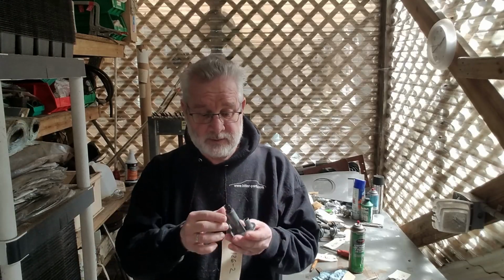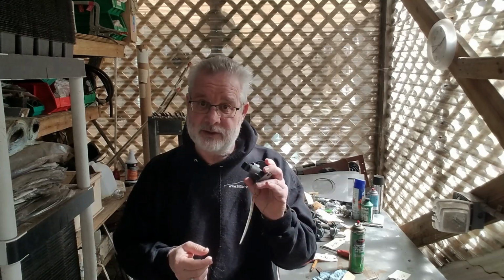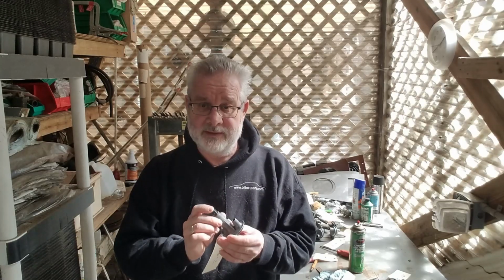If you see mega ohm, something is not right. In the case of that particular one, I had infinite resistance, and then finally saw how badly corroded the contacts were, and once I had cleaned these up it came to the 46 or something that it should have, the 126. So the first thing you do is check the resistance here. If you're in the tens of ohms, you're fine.